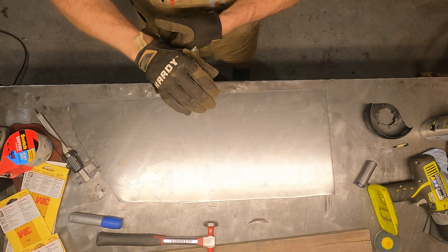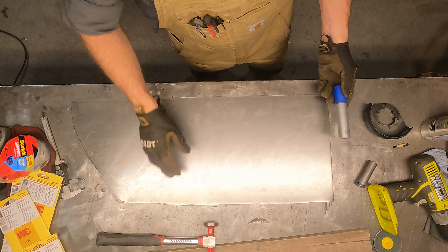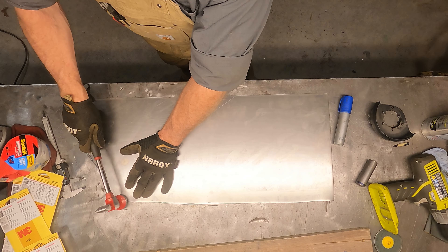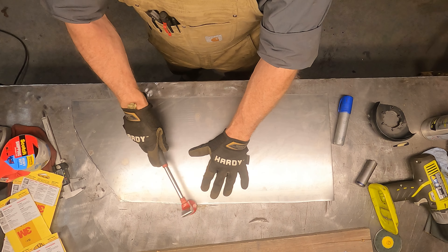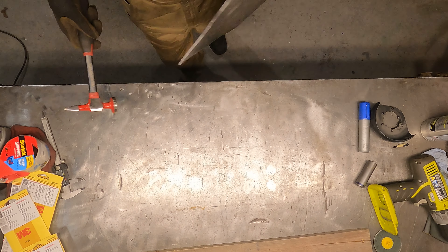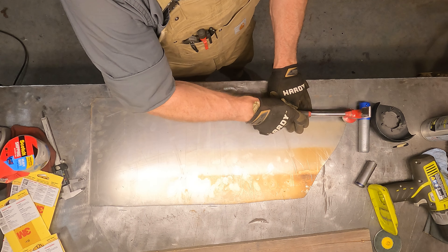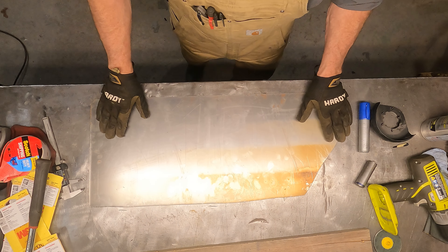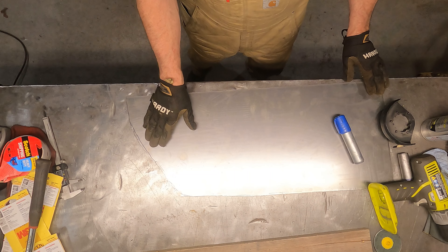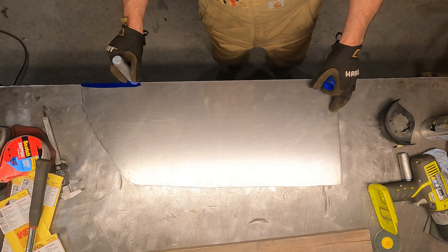Hope you'll forgive me — I just quickly set this up so I don't really have the full view in frame, but this is enough to get the point across. One of the first things I'm going to do is go through with my body hammer. I cut this with the shear and I've got some rough edges. I really want to get my edges flat — basically take down any of the curl the handheld shear might have put in. Here is the orientation of our piece: over here is the arch where the hump goes. This is the back of the vehicle, so we're going to put a little line on here and use my Sharpie.